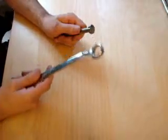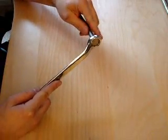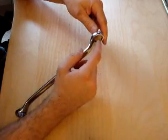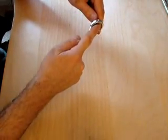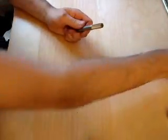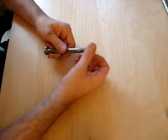Now, I bought this nice offset wrench from AutoZone. It's 19 millimeters and it will fit the head of the bolt. The offset is nice because there's not a whole lot of room in the frame to work with this. You've got the transmission in the way, and then you've got a little recessed area, and then you can grab onto the head of the bolt with this. Because this end is 18 millimeters, you have to use an 18 millimeter nut.